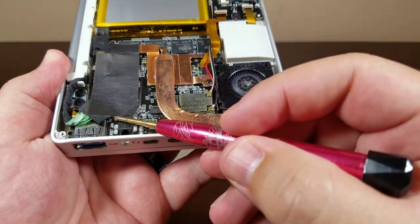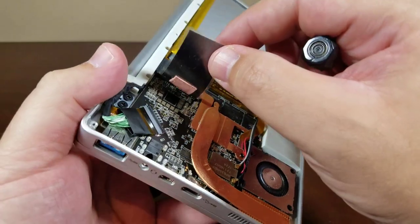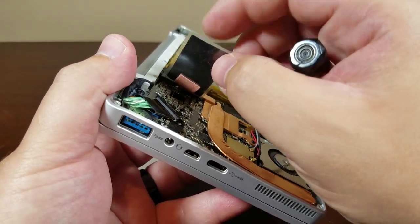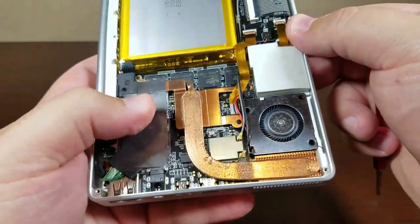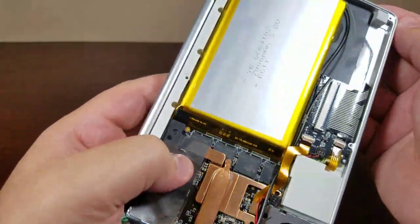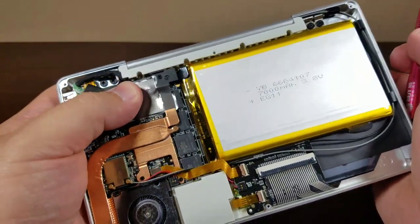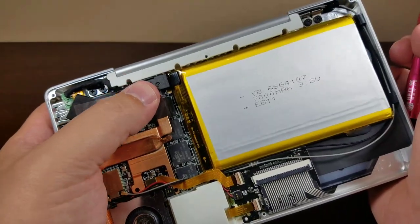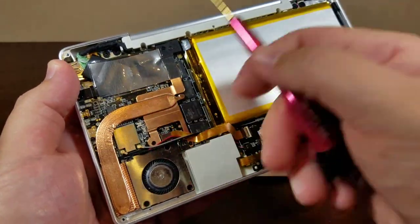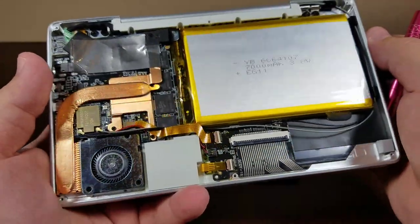Under here there's something interesting going on. This is basically like a Northbridge/Southbridge type thing — a PCH-type component. They have some thermal tape connected to this, and this is kind of like a heat shield spreading the heat. I think this is just being cautious, but the plastic on top feels like a band-aid solution — something done as an afterthought. The rest of the engineering seems well thought-out, but this seems like 'yeah, we'll just put some tape over it.' Right here you can see the display connection, which feeds into the LCD hinge and goes to the LCD panel.